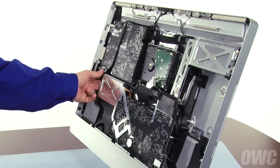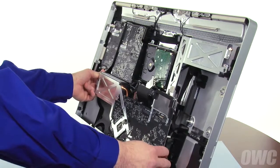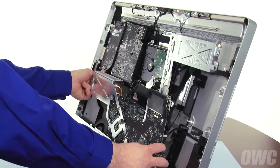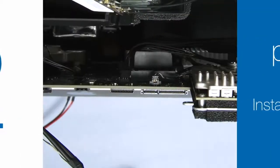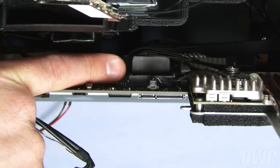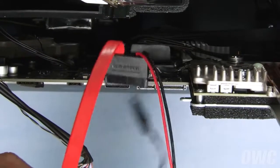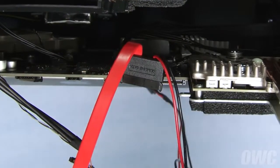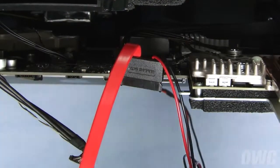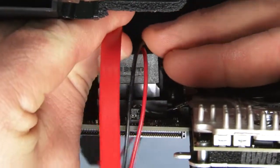With your left hand behind the heat sink and your right hand behind the logic board, gently angle the logic board assembly forward until the heat sink on the left clears the board just above it. The SATA port we're going to connect to is located here, on the back side of the logic board. Arrange the cable that came in your DIY kit so that the thicker cable is to the left and the thinner cables are to the right as you look at the iMac. Once positioned correctly, the connector will simply slide into place.